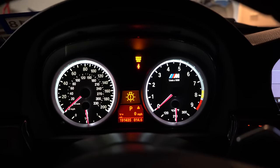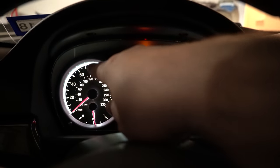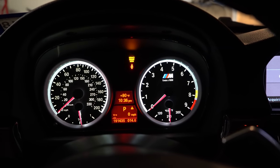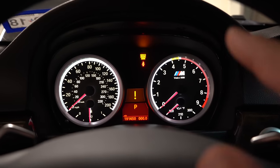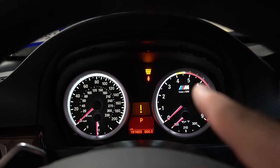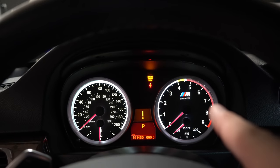Alright, so I took it for a test drive - I floored it a few times. My red line is perfectly the way it should be - it shifts right close to 7000 when you punch it. My oil temp gauge was spot on and everything was perfect, everything was where it should be, just as you'd expect, all the way up to normal driving 80 miles per hour. Okay, so I have figured out my red line. I played around with the numbers until I got it so that at around 4200 RPM it'll go there cold, and then it'll go to 4500 RPM, and then go to 5000 RPM, 6000 RPM, and then settle at 7.